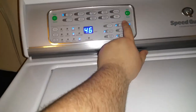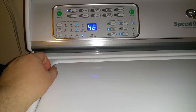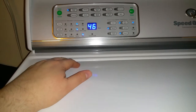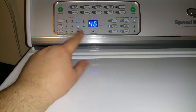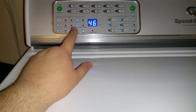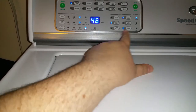When it goes to the main wash, the blue LED light from the pre-wash is going to shut off. I changed my mind — when that happens, I'm going to pause it, reset it, so I can get more hot water in there. Not that much — at least up to the low water level. And then switch it to warm. But I'll still keep it large, still keep it maxed, and still keep the second rinse.